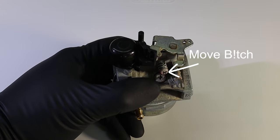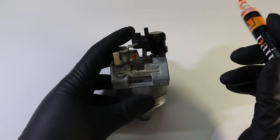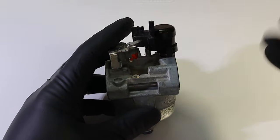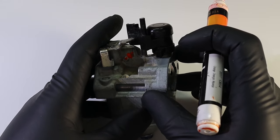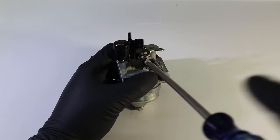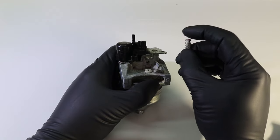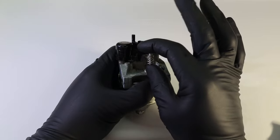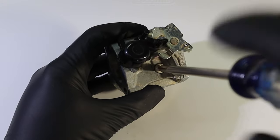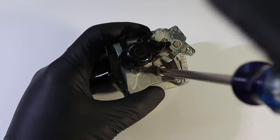You've got a couple of options. Option A: grab yourself a paint pen or a sharpie and mark the threads — this way when you go to reinstall it, you know where to stop or how far to go. Option B: simply count the threads — simplest way possible. Now that we've determined where to reinstall it, go ahead and remove the throttle stop screw all the way out. Just be sure not to lose that spring. Now that you've got that little guy out of the way, you should have a clear shot at getting that pilot screw out.